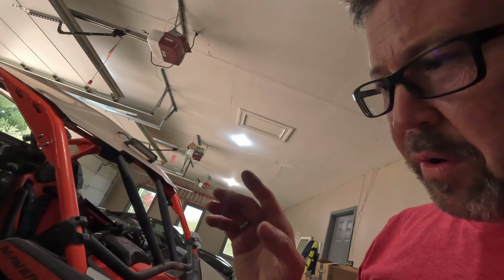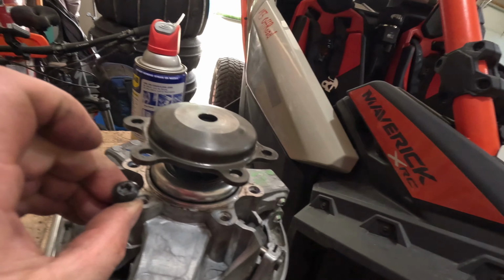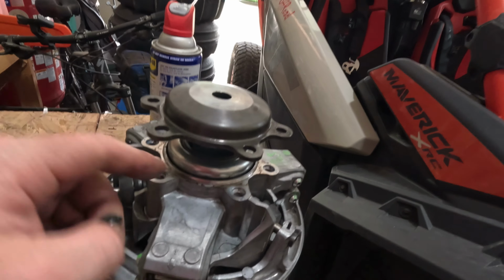All right, guys, so forgive me. We're working on a little wood bench here. It's springtime, a lot of stuff going on here. So normally it's very hard to hold this clutch in one spot while you're trying to work on it, and I'm not joking, these T40 Torx screws that are in here, the way they are locked in almost reminds me of rock set as opposed to Loctite. You heat them up, they'll move a little bit, and they seem to get even tighter.